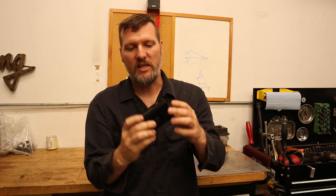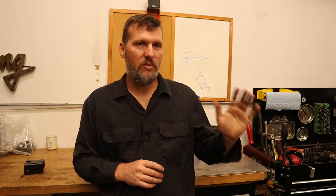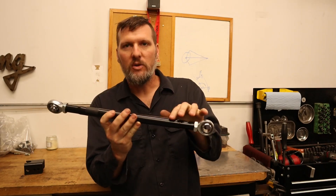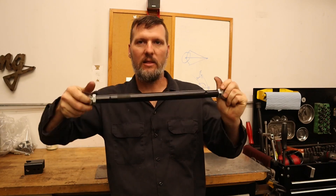This mount will need to be welded inside of the existing bracket and some trimming of the existing mount may be needed to access these holes. I already put a coat of paint on it, as the outside portion won't be accessible once it's welded in. Since this axle mount opening will be narrower, the Maximum Motorsports control arms I currently have on the car will no longer work. They also have a spring perch I haven't been using since I have coilovers, so time to ditch those anyways. I'll be using rod ends with a swedge tube from Speedway Motors. These come in multiple different lengths and have right and left-handed threads to make them easily adjustable.